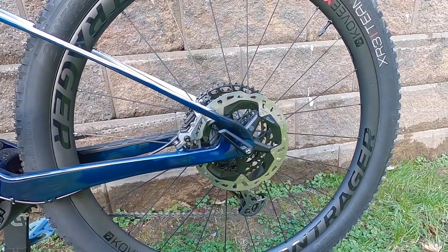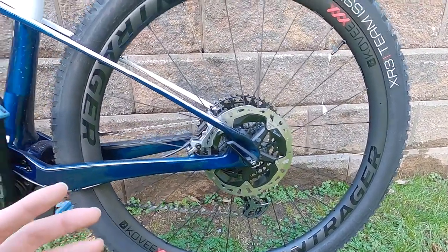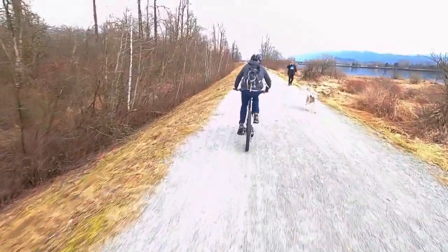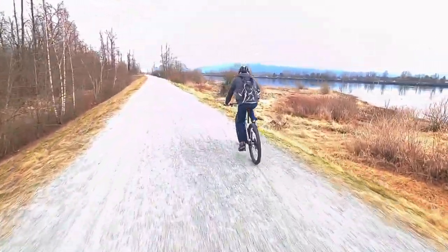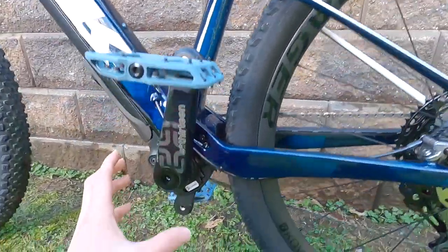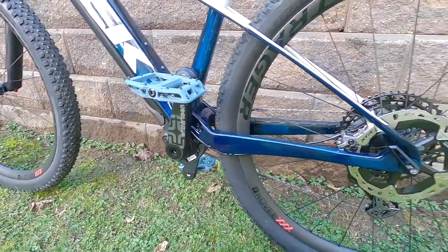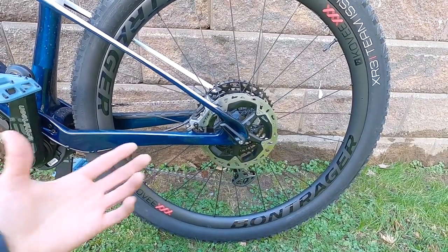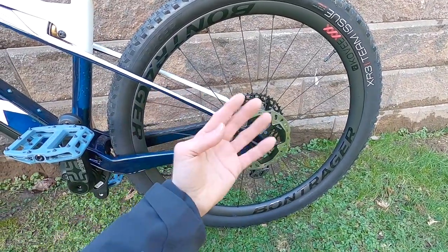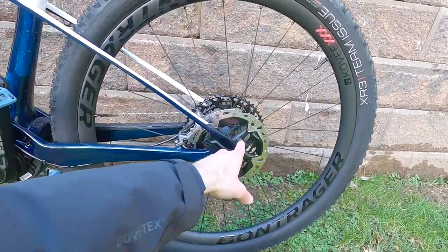I think that makes sense — it works fine in my experience. I haven't really been racing this; it's really overdone for the type of riding I usually do, but is it fun — it's just snappy. It applies pressure to move you forward without losing a lot of speed and power in bobbing, and you have that immediate lockout. You can see there's a magnet to measure rear wheel speed, and you've got pedal cadence and pedal torque sensors — a multi-sensor setup with the drive unit. It doesn't have shift detection like some Bosch systems, but it still applies up to 55 Newton meters of torque, so I ease off to avoid chewing up those cassette teeth.